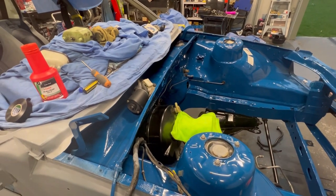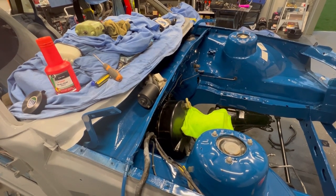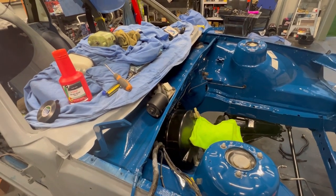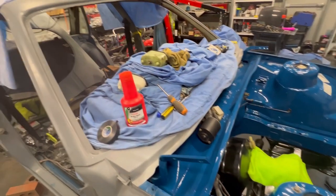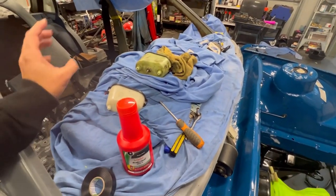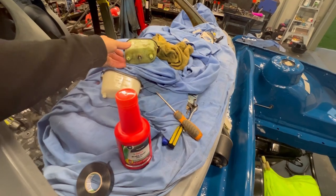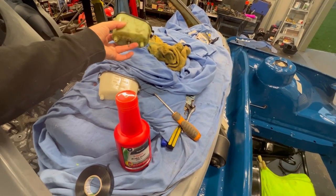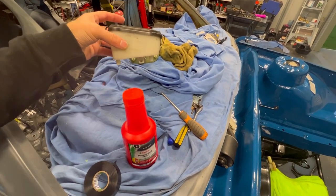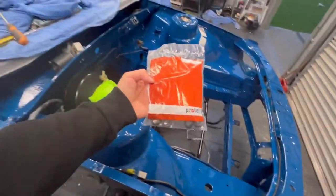In between I did read some bad reviews on this rubber kit that I bought, saying that the reservoir seals are incorrect. So I thought I'd go grab the reservoir off the Statesman and see if we can use any parts of those just in case everything doesn't fit. That's the Statesman one and that's the VK one — as you can see they're completely different: different seals, different mounting at the bottom. The Statesman screws from the top whereas the VK screws from the side.